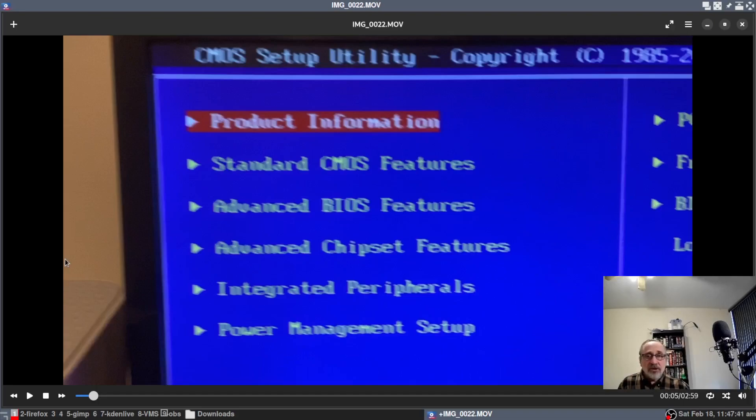In that case, when booting up you'll need to figure out which key to press to enter the BIOS settings — it could be F1, F2, F11, F12, or Delete. On my computer it's Delete. If you want to get into the BIOS menu to change settings, press Delete at the right moment during boot. If you miss it, it will boot into the installed system. Once in the BIOS menu, search for the Secure Boot setting and turn it off.